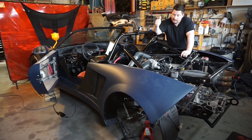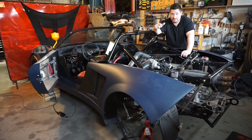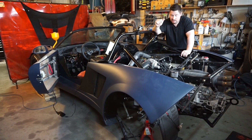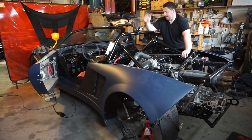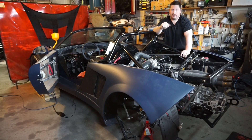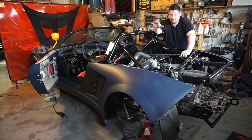The main things I'll be looking at are oil pressure the whole time and bleeding off the coolant. I'll be watching coolant and oil temps, and if I can't keep them under control, I'll shut it down. I'll also be looking for leaks and watching fuel pressure. I have my little panel off the firewall for full access. The fuel connections were never loosened during the engine rebuild, so I'm fairly confident in all that.